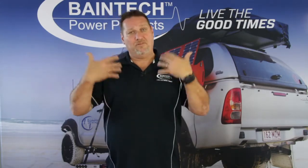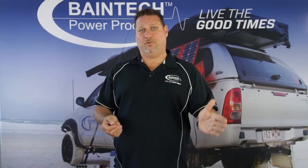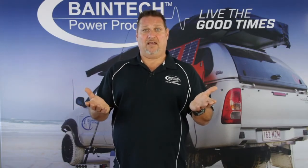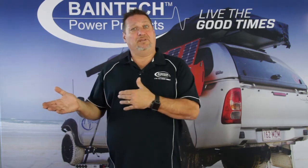The simple reason is the only thing that keeps your alternator cool are the little fins internal in the alternator, turning around with air. They need to turn quicker to keep moving that air and getting rid of the hot air. So if you've got an alternator working at max output at idle, in most diesel cars these days that's probably under 1,000 revolutions per minute anyway, whereas you would normally expect it to run at 3,000 to 4,000 RPM to get its max output, moving a lot more air.